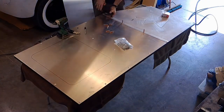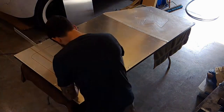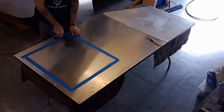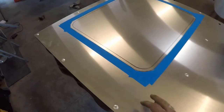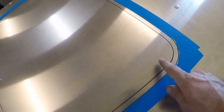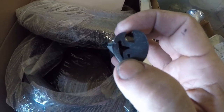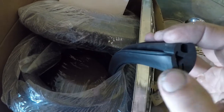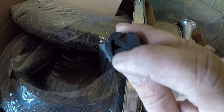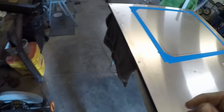To connect the two pieces, the two rivets in the middle didn't look like quite enough — there was still a small gap. So I add a few 1-1/8 inch rivets in that spot and mark out the area around the window to get it all cut out. Here's how the door is looking now. I've got the actual window size marked and then about a half-inch line around it — that's the line I'm going to cut. The weatherstripping I use is 1/16th of an inch on the bottom that goes on the metal, and the top is 1/4 inch which holds in the glass. The distance between where the metal is and where the glass is is a little less than half an inch, so I cut half an inch to give a little wiggle room so I don't break the glass.